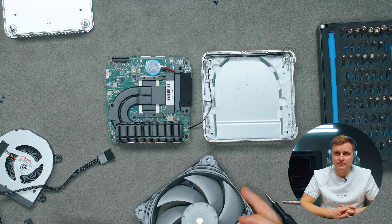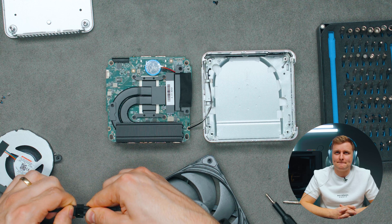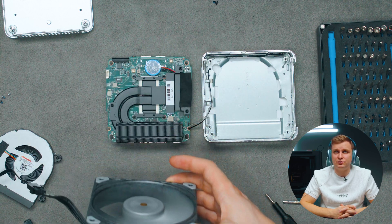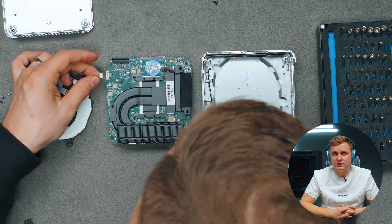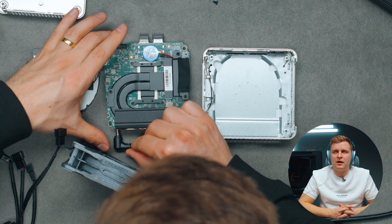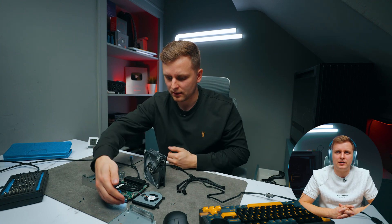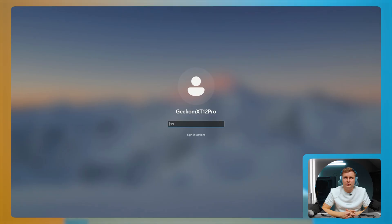Let's see if we can push a little more performance out of this PC. We plug in the PWM extension. This is a Phanteks T30 — a super powerful fan. We're going to plug the included fan into the fan header so the BIOS doesn't freak out thinking there's no fan. We're kind of fooling the BIOS just a little bit here. Plug in the power and HDMI, press the power button — voila, the light comes on and we've got a boot.